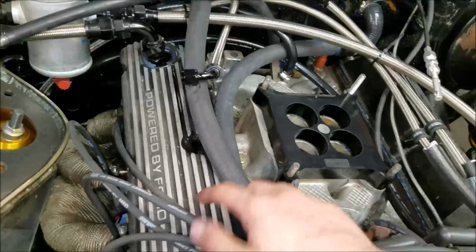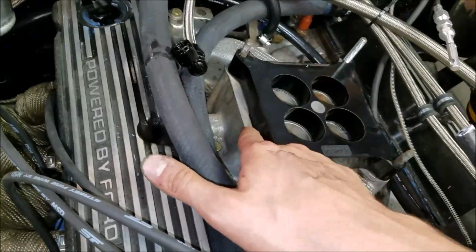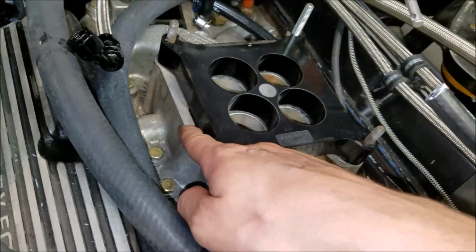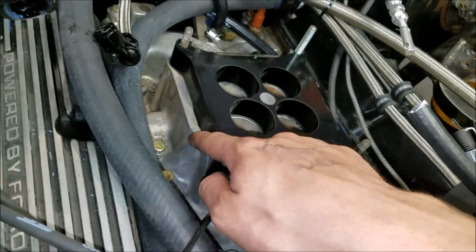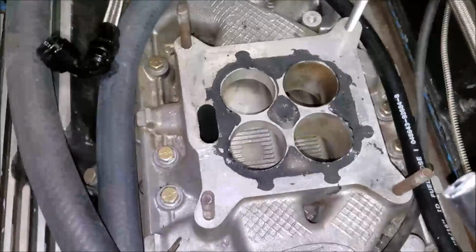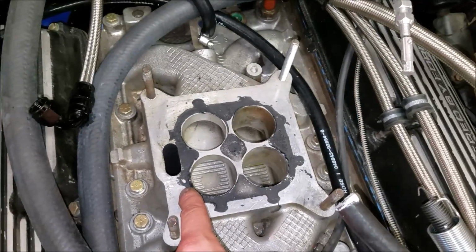Go and lay some pretty good rubber. What we thought kind of sounded like a lifter tick. It seems as though, hold this fuel line out of the way so it's not running gas all over the hot engine, but this is part of the old heat riser on the stock carburetors. This is a stock intake like you saw on my F100 build. But what's going on is, this being an exhaust port, you're actually hearing that every time the cylinder fires, a little click, because we're passing a little bit of air right through here on the intake. And you can see it there on my finger, exhaust gas is coming through. So I don't know, maybe we'll find something to do about that. Get a good look at it here. That heat riser port, or whatever you want to refer to it as, went up to the stock carburetor.